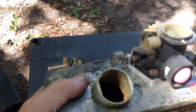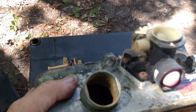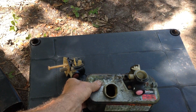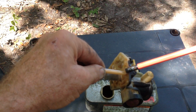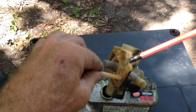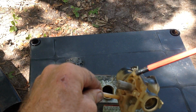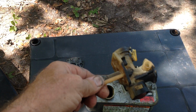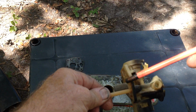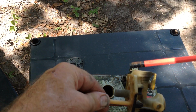That's pretty old for a push style lawnmower. So over time, the plastic in these Pulsajet carburetors becomes warped, and your gas will seep out between the metal tank and the carburetor body.